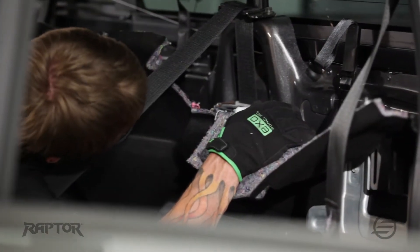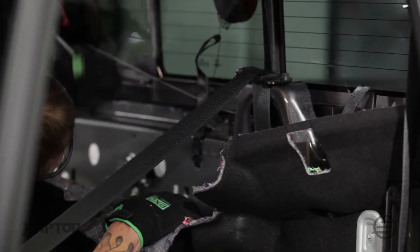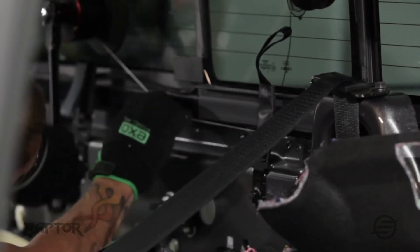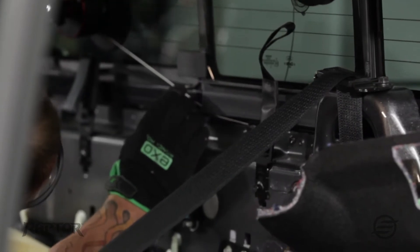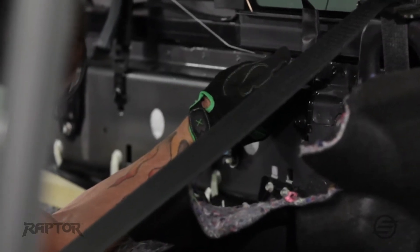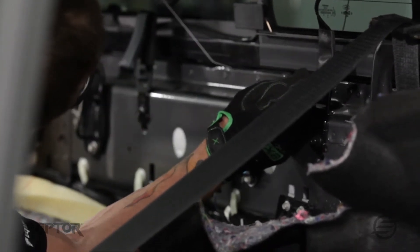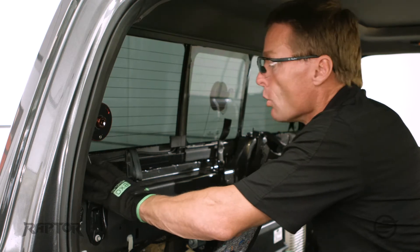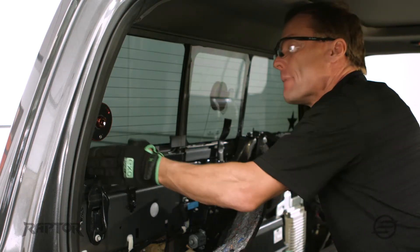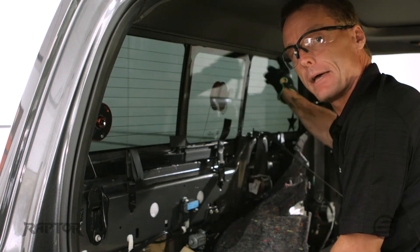Going slow past our connectors here, and we're just going to let the cord ride along the slider. There are wires that run along the edge of the frame on the inside of the slider underneath here, and you've got to be careful to make sure that they don't get cut or that they're attached in the urethane. The whole time I'm cutting, I'm just keeping an eye on it. The nice thing about the ripcord is we can let it ride on the slider and not worry about damaging it. Now that I'm losing my angle, I'm going to bring the cord inside and make this end the anchor, and my anchor end now the cutting end. So it's going to cut from the driver's side, come up and across the top.